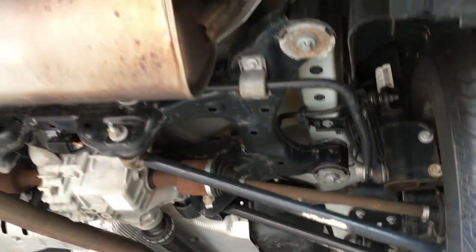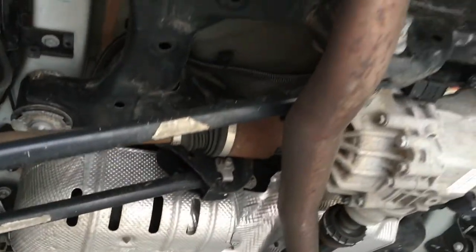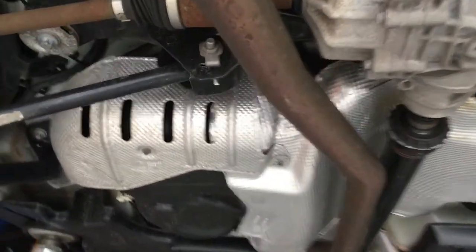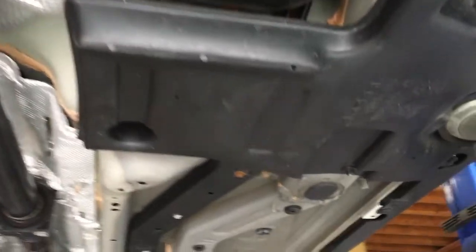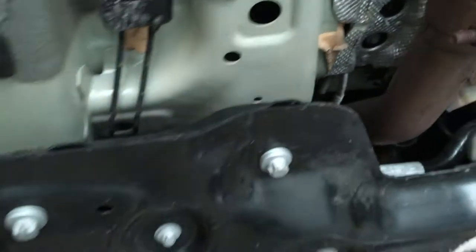Being that it's a unibody, you'll see the rear end is connected with four mounts. This is the subframe — that's a completely separate unit than the rest of the car. So the front and rears are set up in subframes. You've got your gas tank that goes from driver on this side all the way to passenger side there. And then as we go forward, this is just a little guard for your brake lines. Over here, you're going to be running fuel and fuel return line. On this side, you can see the two separate brake lines.